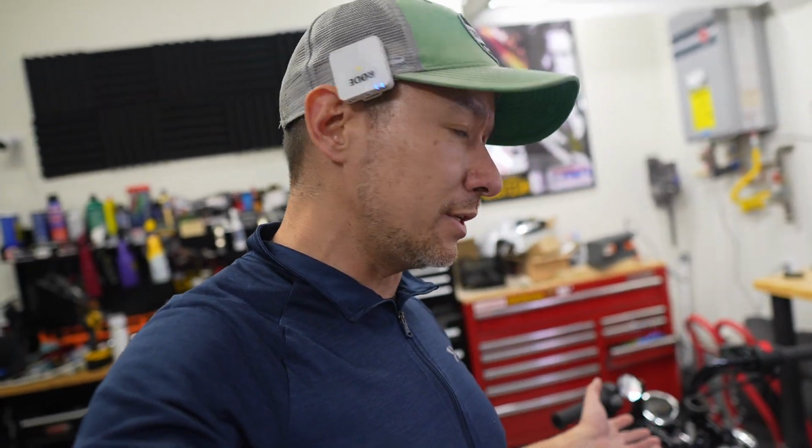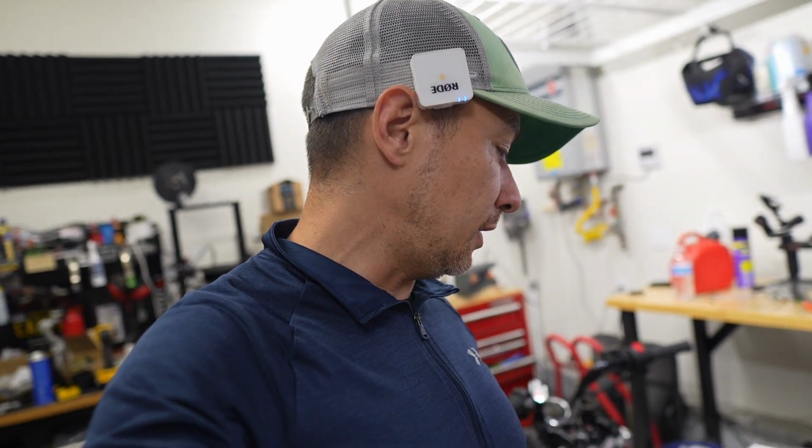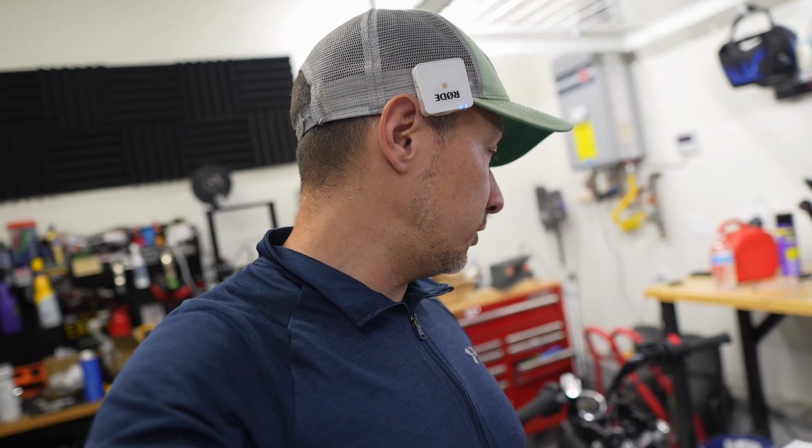It's got the cute blinky eyes, but aside from that, shows almost no information. I'm pretty sure this doesn't even have a clock. Definitely doesn't have a tachometer, and the tachometer is important for me, especially as I start doing some performance modifications. You need to know what RPM you are at to be able to figure out where you are in the power band. It also lets you adjust the miles per hour that's displayed on the gauge, and that'll be important as I change gearing. There's just a lot of features, and again, we'll get into that once we get it on the bike.